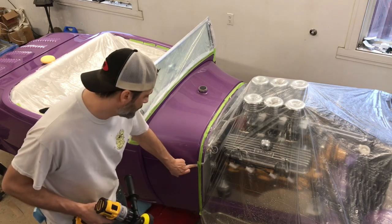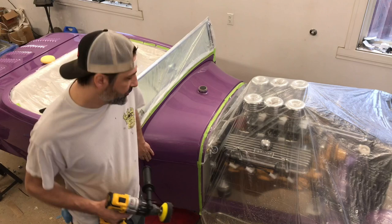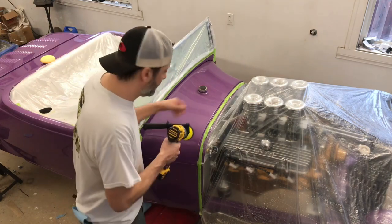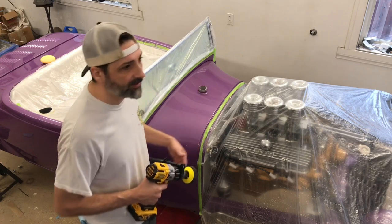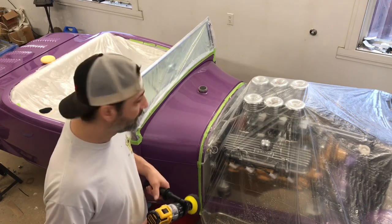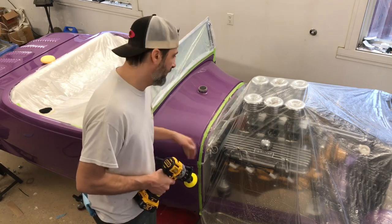As well as you gotta watch all your corners, your lines. You could even put tape on there. You don't wanna go near like a corner, especially if you're going with the rotation into the corner, it'll dig in, take off the paint. It's instant. So what you wanna do is when you buff, you go off. Always fluffing off.